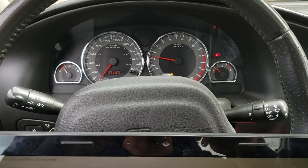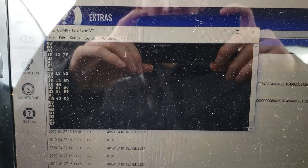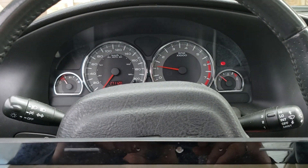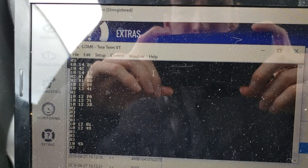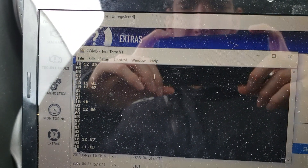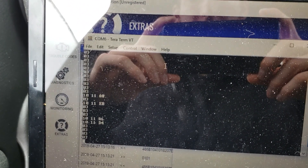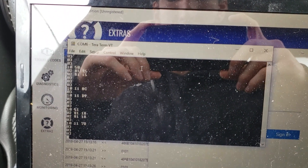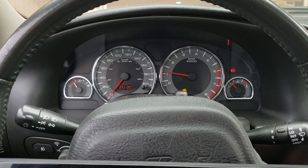So we're in the car right now, and what I'm trying to do is — I have an ELM327 connected to the OBD2 port — I'm trying to figure out what messages control the gauge cluster. You can see if I give it a bit of gas, a bunch of different data comes up. What I'm trying to do is isolate the RPM, the speed, and the water temp so that I can use an Arduino to do the conversion between the ION ECU and the wagon ECU, to get the gauges working in the wagon. I'm going to open an Excel chart and start looking at these numbers to figure out how to control these gauges.